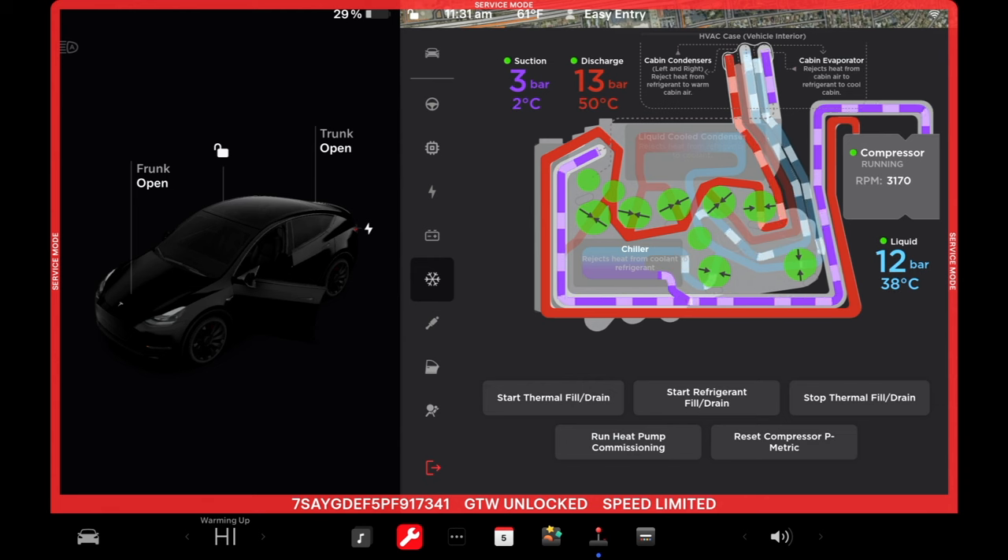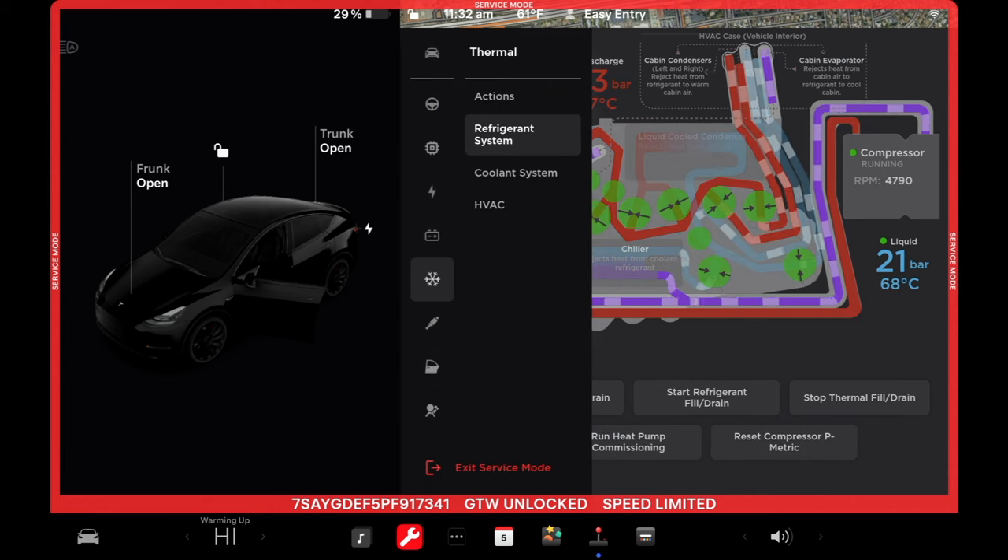This vehicle no longer has an air exchange condenser out front — all we have is a radiator. The only condenser is the liquid cooled condenser. You can see we're running through the liquid cooled condenser but not the chiller — those valves are shut off. Now switching to heat mode, we take the condenser out of the loop; our new condenser is actually inside the cabin, and that's where we're going to reject heat to warm the cabin air. If you own one of these Teslas, I would encourage you to explore — especially when you go to a supercharger — watch some of these temperatures and pressures and watch what's happening.